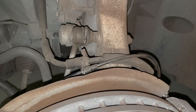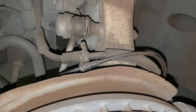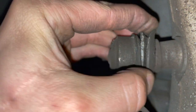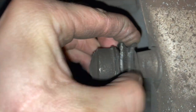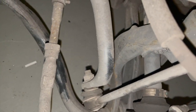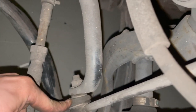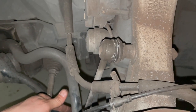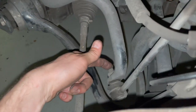So I've got the driver side buttoned up and now I've moved on to the passenger side of the vehicle. As you can see, on my passenger side this stabilizer link has definitely been leaking and looks quite corroded. It definitely needs to be replaced. I'm going to remove the nut from here and the nut from down there, and replace this side as well. I will get back to you on the test drive and tell you how the vehicle feels once this has been replaced.